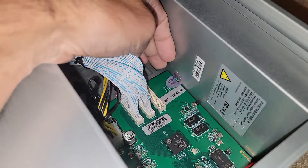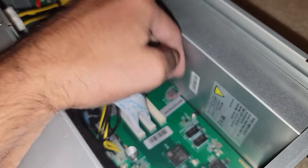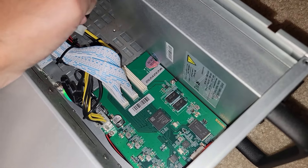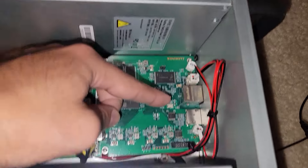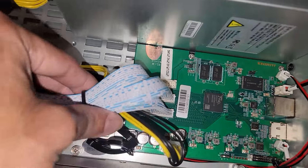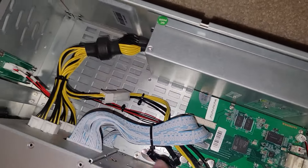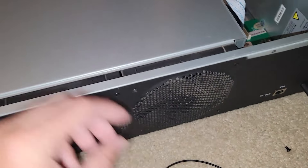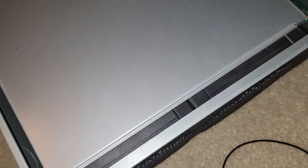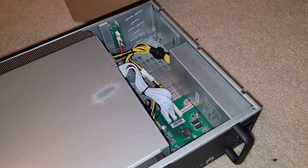We might not need to remove it because the control board is just below it, but you can see there's a sticker here — obviously if I do this it's going to void the warranty, but I believe this thing's already outside of warranty so it's not a big deal. We might not have to remove the power supply, but we definitely need to disconnect these ribbon cables and power cable. There's a front panel connector right here, here, and another one right there. We also have four-pin PWM cables going to the fans on the back side. Those fans can be replaced with Noctua fans — just make sure you're getting the slim 120s, not the normal thickness we're used to on a computer.